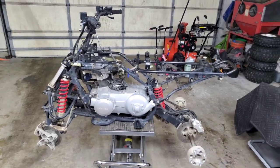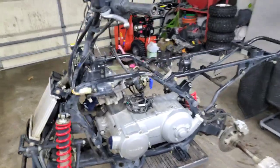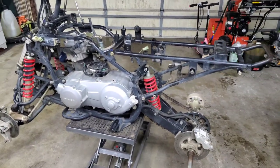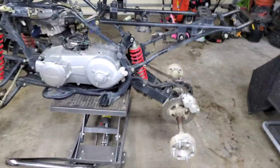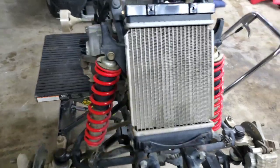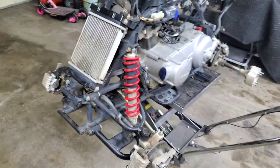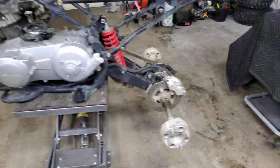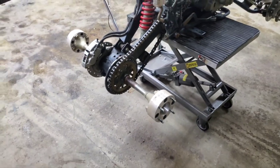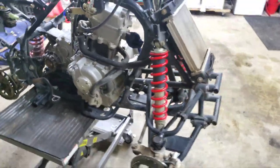2005 Kymco Mongoose 250. The Kymco Mongoose 300 and the 270 still retain the same exact frame — looking on Partzilla, at least between the 250 and the 300, they do, I know that for a fact. I'm going to try to upgrade a few things to make it a little wider, because the 250 is super narrow, at least in the front. With the wheels on it, I measured it — it's legitimately 38, maybe 39 inches wide outside of the tires. Super narrow. In the back with the spacers — there are two-inch spacers on both sides — I think it's at 44, maybe 45 inches.